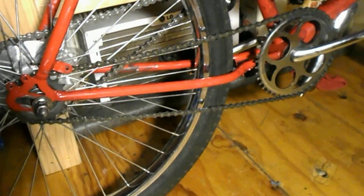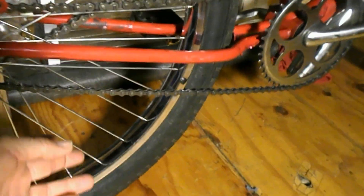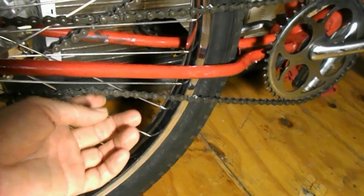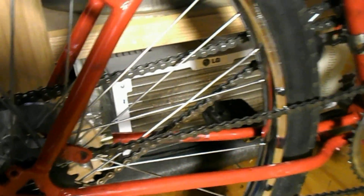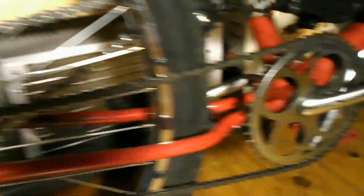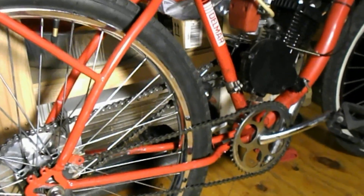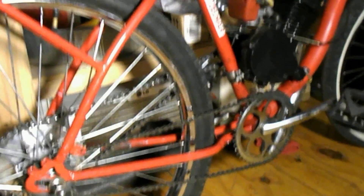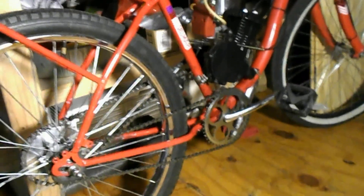I forgot to take a shot of this yesterday, but this is the finish — this is me finished. I haven't put the chain guard back on. The chain has still got a little play in it; I could probably put a half link in it but I'll probably leave it there. The other side is good and tight. The spring tensioner is on, it's all lined up — this is what it looks like on the finish side, on the bike side. We're gonna be riding here pretty soon, I just got a few other odds and ends to do. The speeder bike is gonna be on the road again.